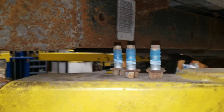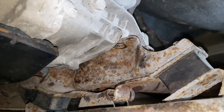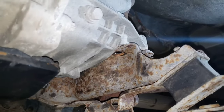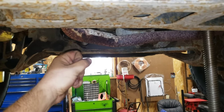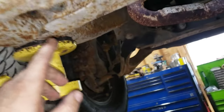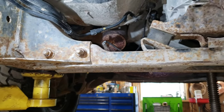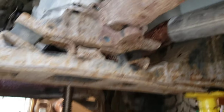We have everything disconnected. As I turn our screw jack, you can see the transmission kind of lifts off — that means we're disconnected. So it's 17 on this side and a 19 on that side. I'll need to put a 17 wrench on that side and come at it with my half-inch gun on this side. I've already made sure all these bolts do spin — sometimes they'll get caught up and corroded, especially where we live. But they're turning so I think it'll be pretty easy. Make sure your transmission is supported. Onward and upward.